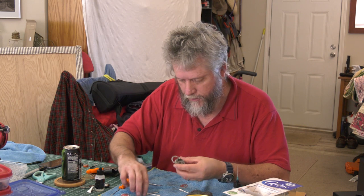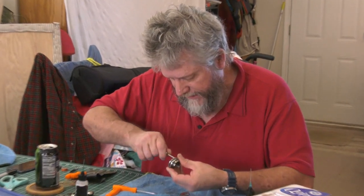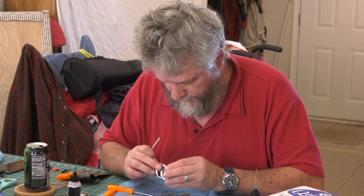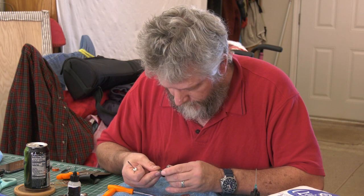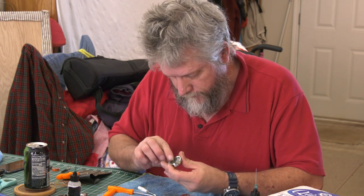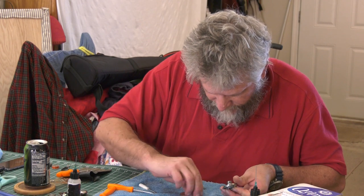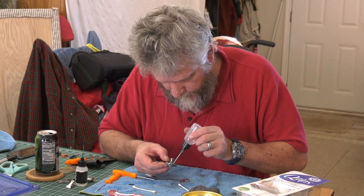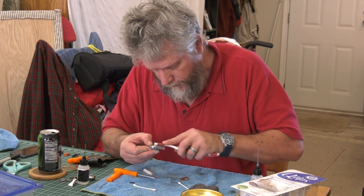Okay. Now we're going to put the gib hook back in, and let's see if we can line it up. This sometimes can get a little finagly, lining it up. And I'll tell you up front, this one, the screw didn't drop out, which even gives it a little bit more fun, because you don't have the ability to actually look down in the hole. And there we go, it popped out. And since it did, I'm going to drop it on my tray. I'm going to drop in a little bit of kerosene and wiggle a brush in there a little bit. Maybe I can clean the threads out a little bit.